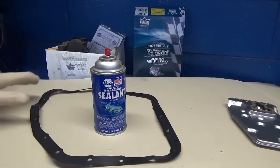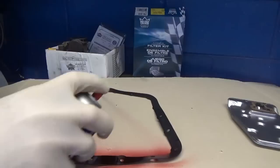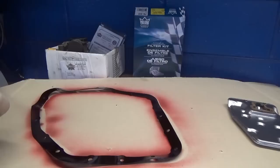I've gone out and figured out which side is going to contact the pan, and that's the side we're going to spray. Usually I'll put one layer on, let it sit for a couple minutes while it's still draining, then come over and put another layer on. I might put up to three layers on — it'll give us a really good tack and really help us putting this back together.